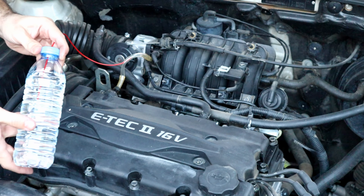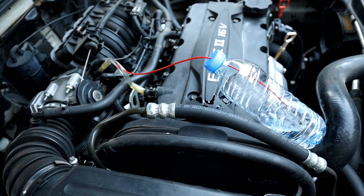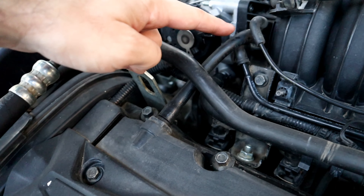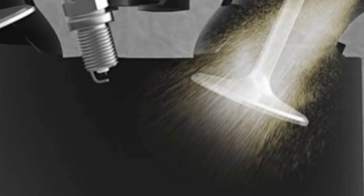Hello, it's Alimic. In today's video, we're gonna try intake valve cleaning with water and see if it's cleaning or not. To do that, we're gonna need to enter water after the PCV valve and then it goes to the combustion chamber from the intake valve. Technically, the water that contacts with the valve cleans the carbon buildup.